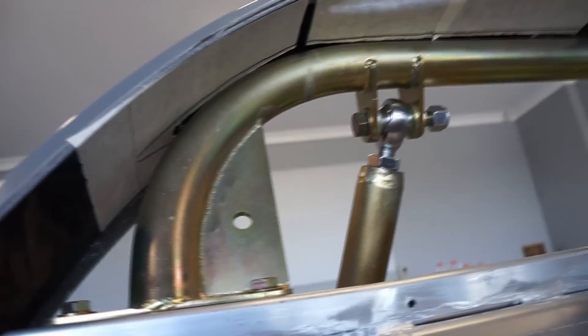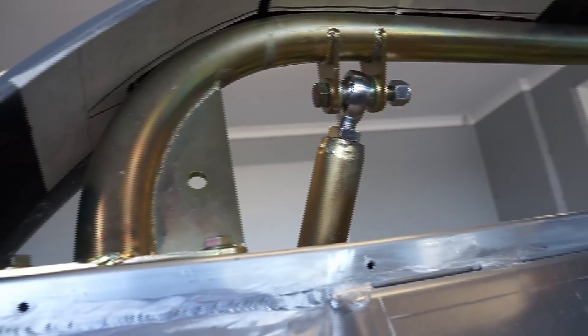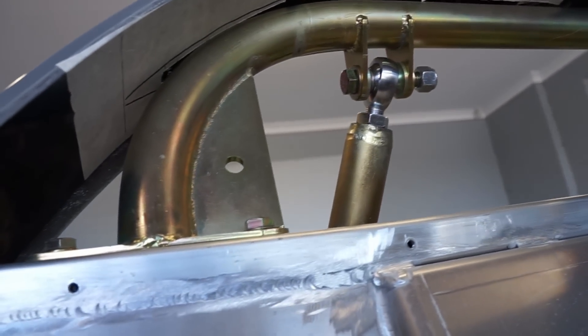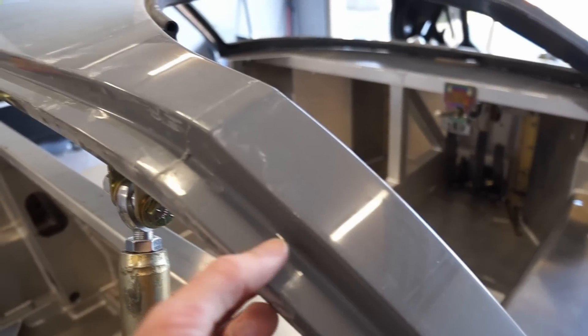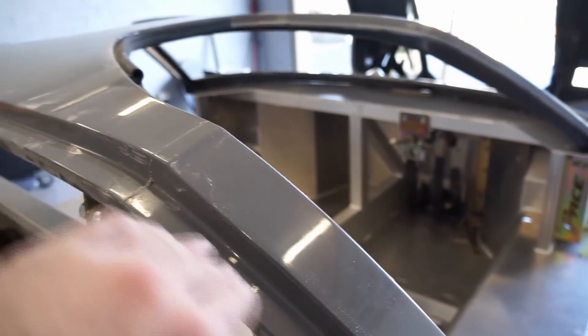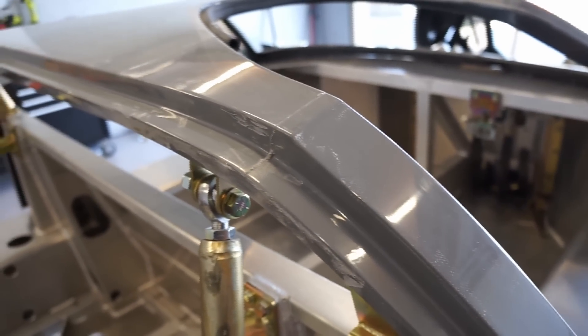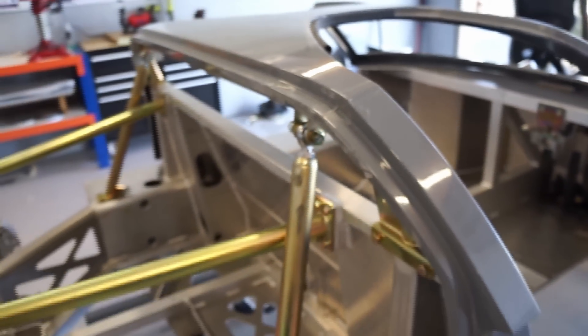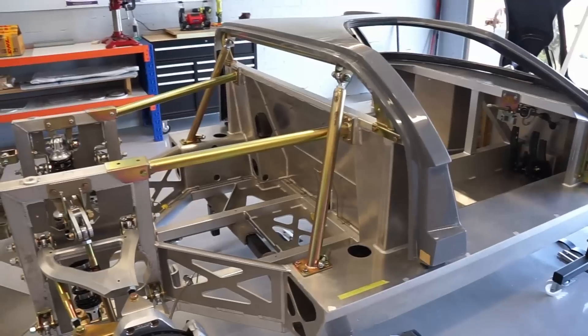You can see there the black texture lines — I think this time I'm just going to go all the way to the lines on both sides. At the back I'm starting to get close to this little return lip so I can't really trim too much more of that internal panel, but what I might do is try and shave it back on a bit of an angle — like a 45 degree angle — just to give a little bit more clearance for the curve of the roll bar. So I'll go do that and check back in after that adjustment's been made.